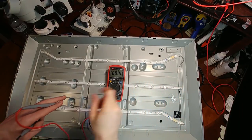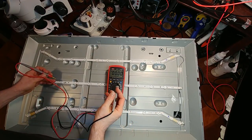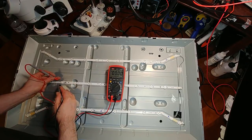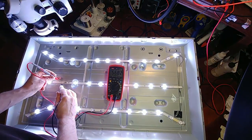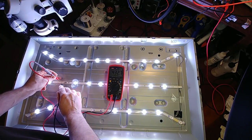I have the TV plugged in with my current meter set to milliamps. I should be able to use the meter to close the circuit on this open LED and get light — and there we have it. We are drawing 432 milliamps, which is pretty high.